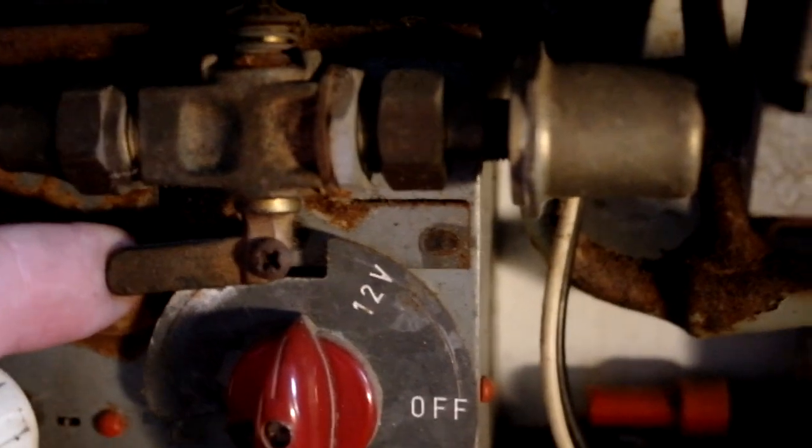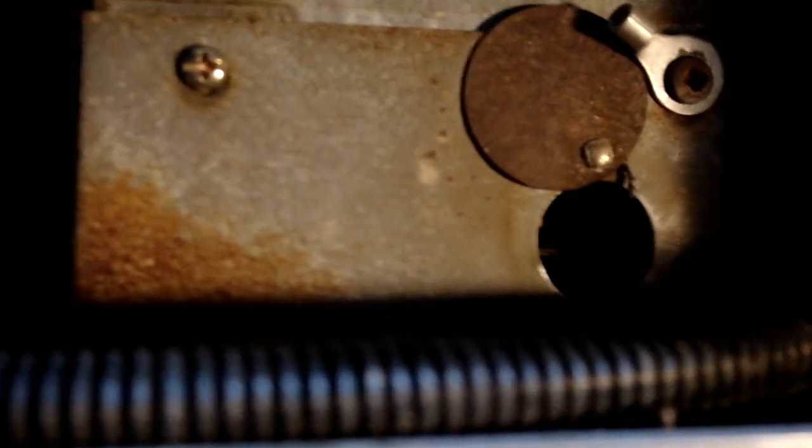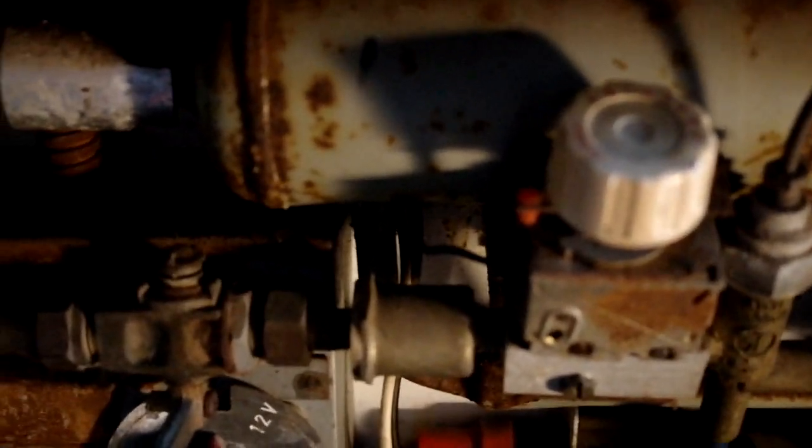When you're getting ready to leave your campsite and shutting things down, you can turn your propane off at the front of the trailer. Make sure that this gas valve here is out, and we see that that shuts off the pilot. You'll probably hear a small click in about 30 seconds, which means the safety valve automatically shuts itself off. I've never needed to play with those dials at all — I keep it on the coldest setting. It's probably best not to move those; it's just a matter of getting your pilot going.